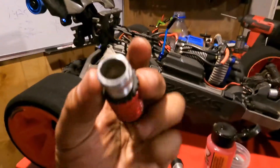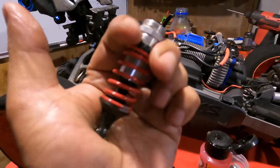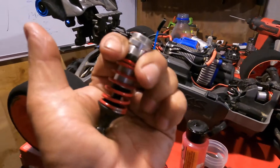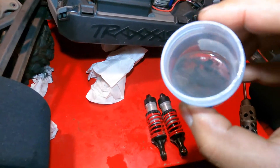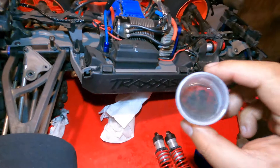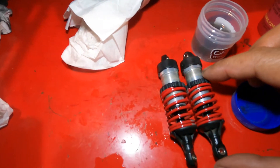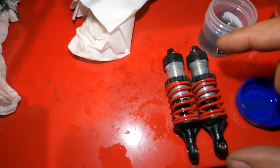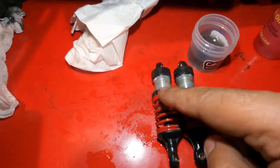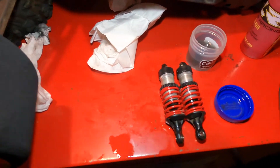Let you guys listen to this shock — the small travel it has without the oil so you can hear the hissing. It does have a little bit of slack, and that's what you want — a little bit. It gets really strong with the oil but it does have that slack. In the front we have about the same amount of slack, only this rear shock is more extended so the rear end can stand up. I measured it and took out two sets — whatever's in here matches what's in the bottom — same equal amount. Everything is nice and set.